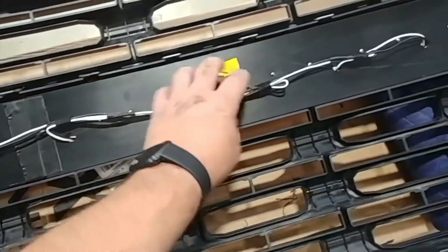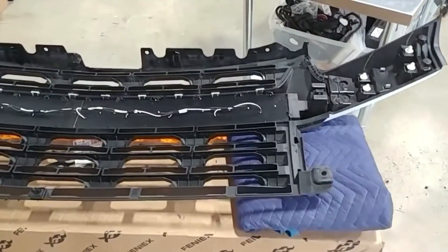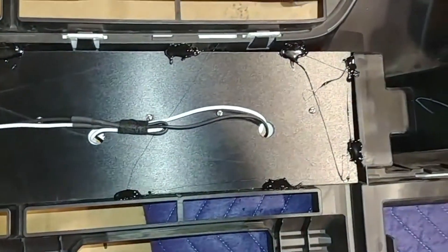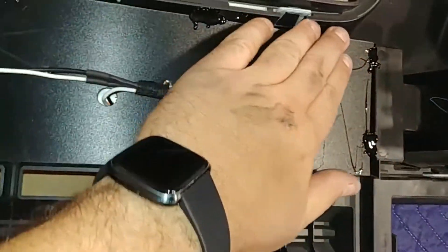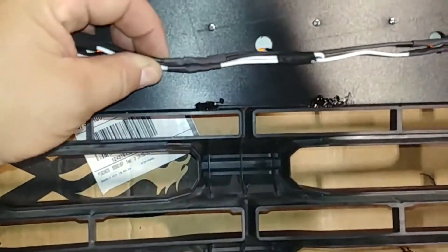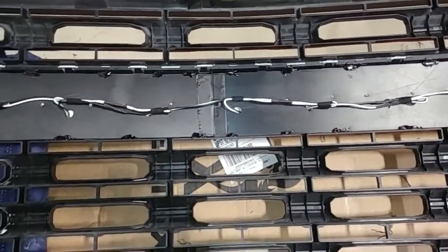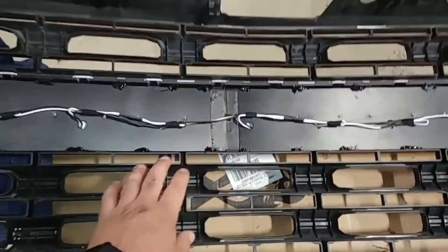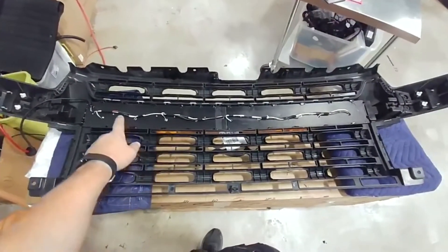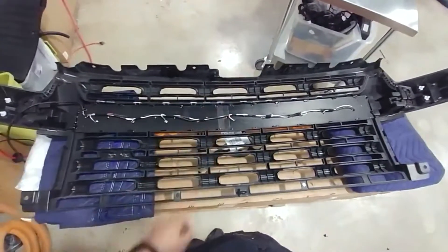Basically just hit some industrial hot melt in the corners to secure this in here, then apply your power and ground. After the hot melt, you can see I'm just popping it into the corners, locking this all in. I was debating covering up all the wiring but it's nice and tight and completely waterproof so I might just leave it — you don't really see it. I could put some headlight sealing tape over it to cover it up. I did put a little strip of tape through the middle. I found if you split this in two it's better and easier, because when I tried to make this out of one piece, the grille has a slight curve to it and it became a pain. So I split it in two and it worked out nicely.